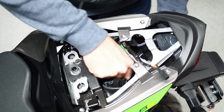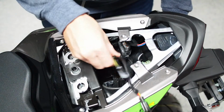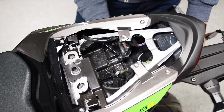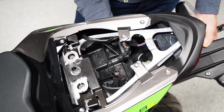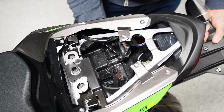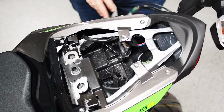And you really just have to take a little bit of time to push out one connector from the fender at a time, because they're kind of running out of this triangular hole that's only really big enough for that big chunky license plate light connector. So got them out one by one, and we'll break this fender down on the bench.